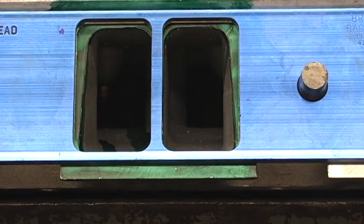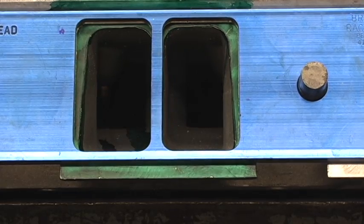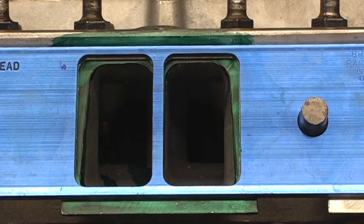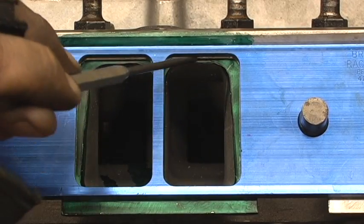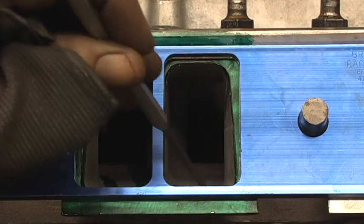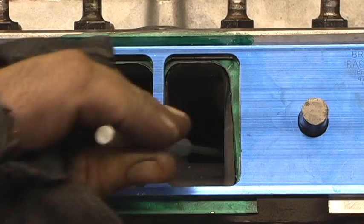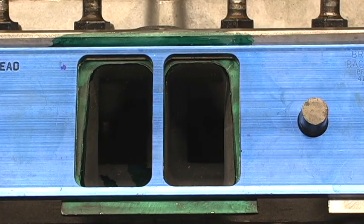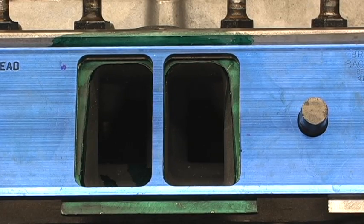What we just did was take it instead of the stock location being on the bottom — making us have to cut material out of the bottom, which does no good to smoothing out the floor — by putting this in a raised runner situation, to making us have to cut the top. Now the problem is going to be, number one, the gasket will have to be modified. Or Felpro makes a 1206 with a 200 raised runner roof, or it's a blank gasket I can carve to fit. That's a little more trouble, but the benefit gains off cutting the meat out, making it match on the top, raising the floor up, and bringing that up is going to straighten this shot and not make it transverse where it's got to come up and then go around. We're talking a secret hidden performance gain here that not a lot of people are going to know about. This is a great thing. I'm going to show you the difference between the two and what we're looking at now.